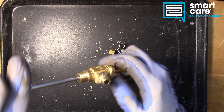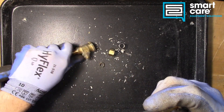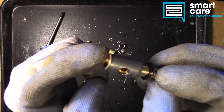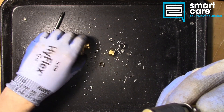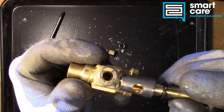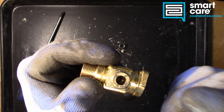Let's pop that back apart again — you can see that opening. So there's that same opening drilled through the side. And all we're doing when we turn the valve is exposing that further in the inlet — giving more area of that hole to the inlet for gas to flow through.